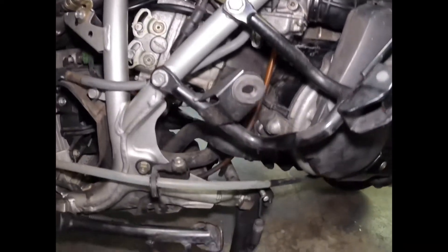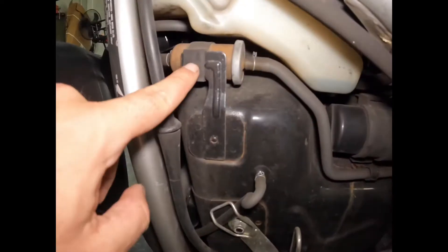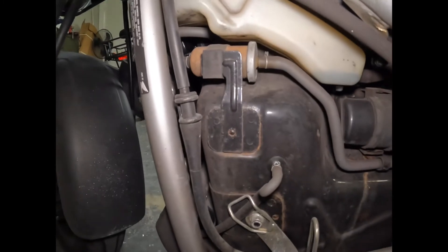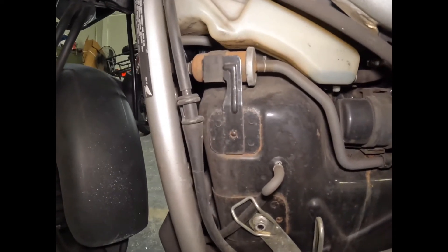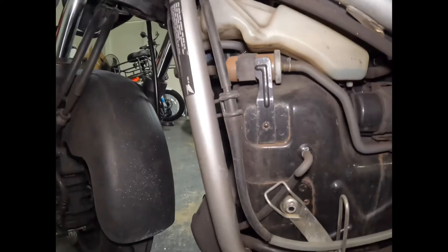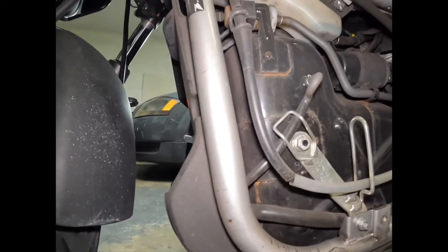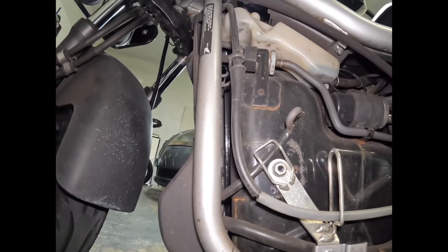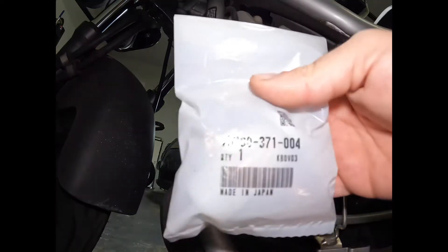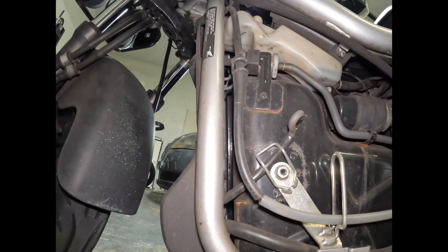Always good to take a quick inspection once the panel is off — see if there's anything crazy going on. Everything looks pretty good here. What we're after is the fuel filter right there. Just looking at it I can tell it's about halfway full, which makes sense. Being a 2006 and it now being 2022, you can do the math on how old that filter is — this is exactly why I went ahead and ordered one. You can get them for about $25, not the cheapest, but that's the part we're going to replace. I'm going to grab a tray because I'm guaranteed to spill some gas.